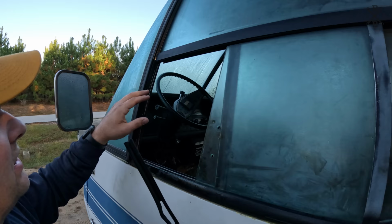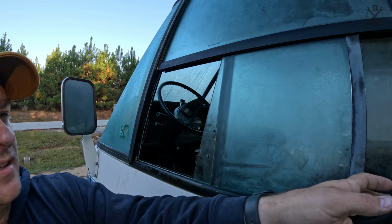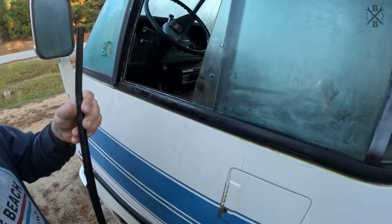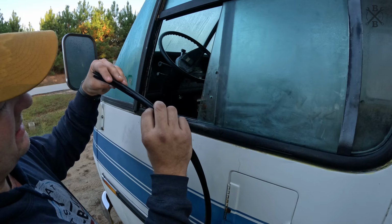Now for a front window, it goes in three different pieces. So we've already gone ahead, obviously, installed the front. This little strip here, and I'll go to the bottom. Now these drains actually come in a little bit different. They come in kind of from the side. So something to be sure you do is cut it out kind of like that. Should give us what we need there.